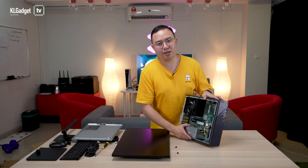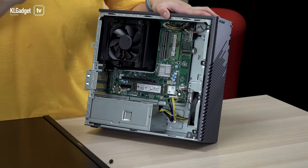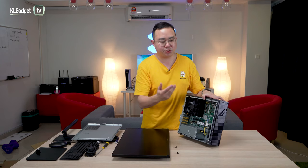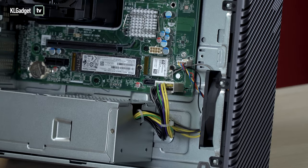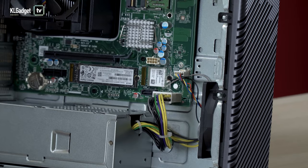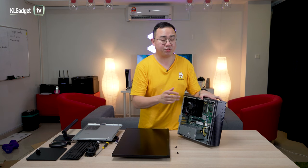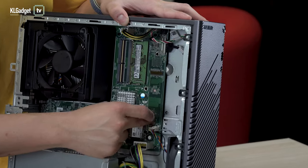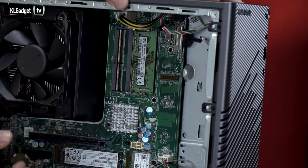What we're seeing here is an ITX form factor motherboard with very limited expansion options, which is expected for desktop OEM motherboards like this. Fortunately, we still get some expansion options. You get a SATA connector if you want to expand storage with a SATA SSD or hard drive, though there's nowhere in the chassis to mount a drive — good just in case you want to switch to a bigger casing. There is also a PCIe SSD slot, which is the recommended way of expanding storage on this device.